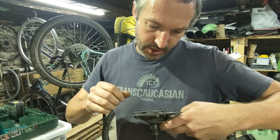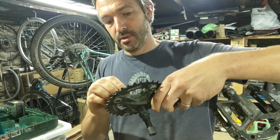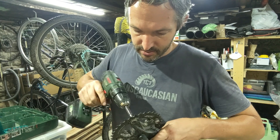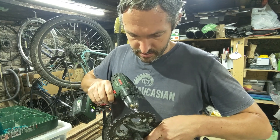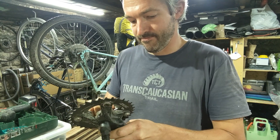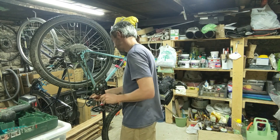Put the ring on, put the new bolts in, and make sure that it's actually the right way around. This has some wear on it so I want to make sure that the chainring teeth are actually pointing in the right direction relative to the existing wear, or else we're going to have some interesting chain slip issues or chain suck. Tighten them up by hand — I'm maybe taking this off again shortly so I'm not going to overdo it. Then reattach to the bicycle.